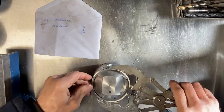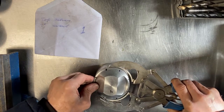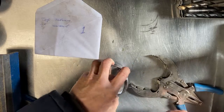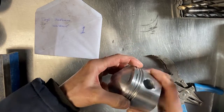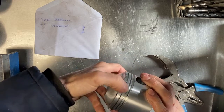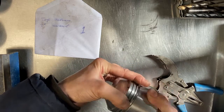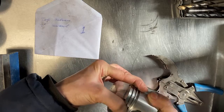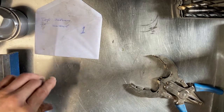The next step is to fit a piston ring. Push down the piston ring slot into the piston ring groove and rotate it to make sure it can rotate freely. If there is a burr in the lateral gas port, the ring will cut it down.